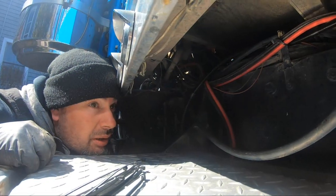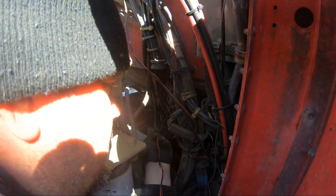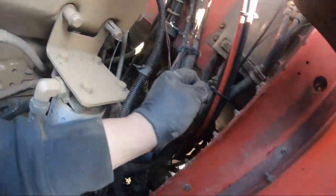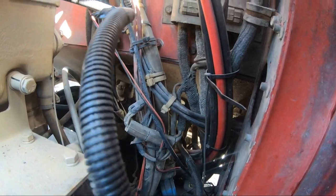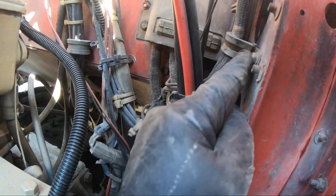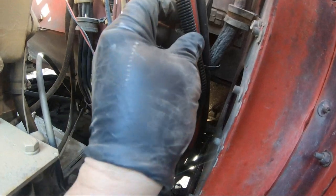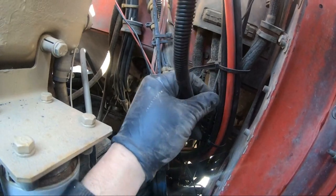That's a lot better back there — I can just zip tie it. I want to go on this side of the steering column. Now I have this loose zip tie here — I can see a clear path right through there, it's nice and free-moving so it's not pulling on anything. I'm going to cut this zip tie and integrate it with this factory tie-down holder and follow this all the way up. This cable is stiff so the other stuff won't flop around — that'll eliminate any chafing.